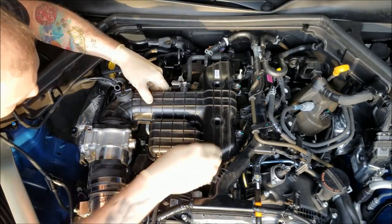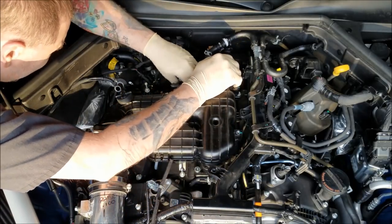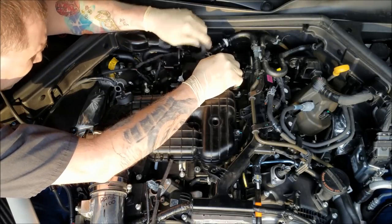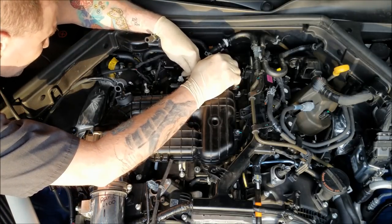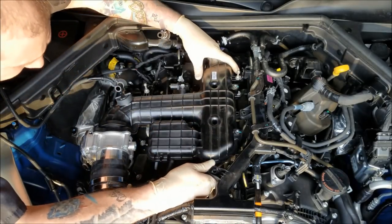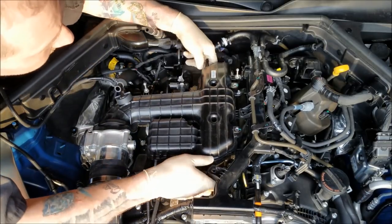So remember, I got those coolant hoses over here. So what I got to do, I got to get this manifold to come up high enough. I got one more clipped. Oh, look at that. So what I did is there, I had to pop the back of mine out of the line clamp. It has a little zip tie line clamp. So, all right, so now we come up. We're gonna try to swing this intake manifold up and out of the way.